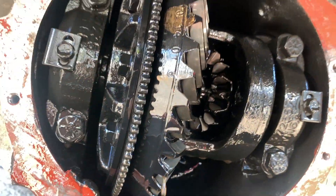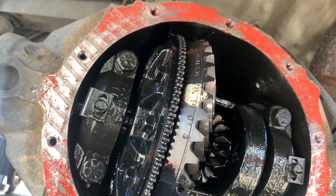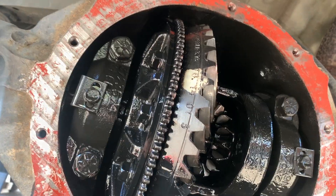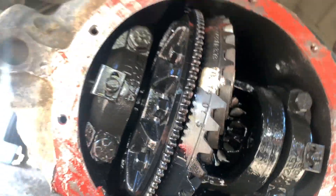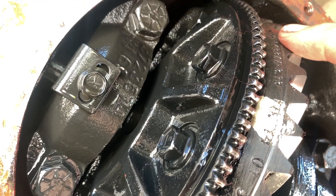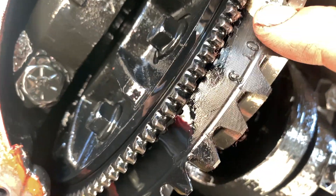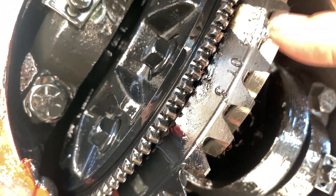Normally they'll put the gear ratio on the axle here too, or on the ring gear. You can see we got a part number — the last part of the part number is 373, just like the tag on the differential. Right after the part number: 373. I'm guessing this is maybe some kind of date code.